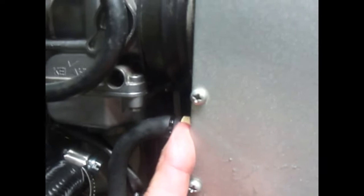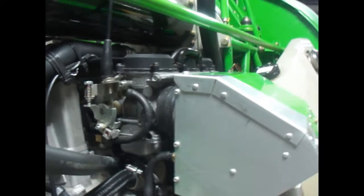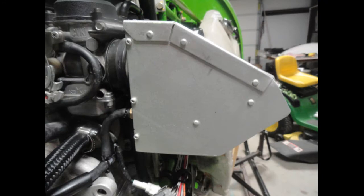This right here should cure the problem. The crankcase and the oil are tied into this tee right here, and it goes into the breather box on the clean air side, and it is pulling good vacuum — so that should take care of it. That's what I would suggest somebody do with their Yamahas. Of course most Yamaha guys are putting single air filters on there, and that's really not what's supposed to be on there.